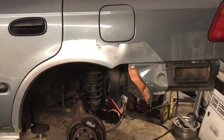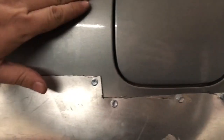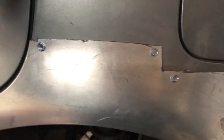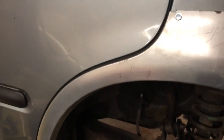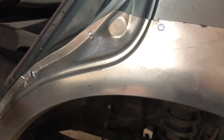Okay, so we got the piece test fitted. Like I was saying, I'm lapping it, so there's always gonna be a lap — this is gonna be always higher than here. But technically the body line is here so I can feather up to this. So it won't be too bad, but again I'm welding this solid all the way down and up here, which is gonna bring that all up and give me more area to blend in my panel because this is gonna be a boxout.